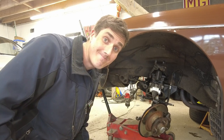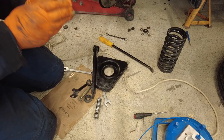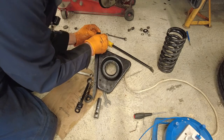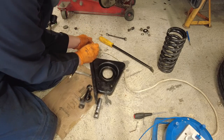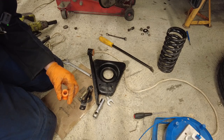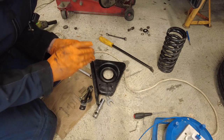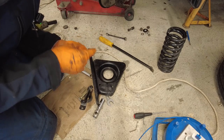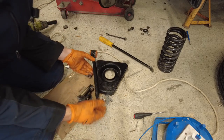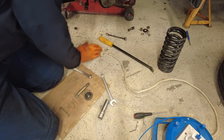We're going to grease up our bushes and insert them into the holes - insert tab A into slot B. We're just literally going to butter up the bushes inside and out, and because these are in two separate halves they just literally pop in. Do the same on the other side, and then we'll get all of this reassembled. That's one side done.